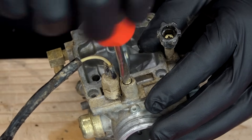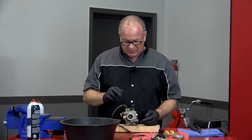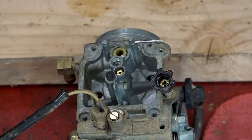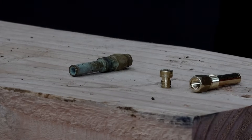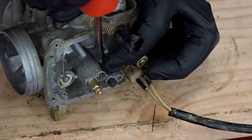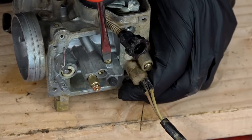The reason this adjustment even exists is so you can adjust for different changes in altitude — if you were running at a real high altitude you'd only run this maybe one turn out versus two. Next, let's take a look at what I call the slow jet. There are no O-rings, so just go ahead and drop it in — just go until it's seated. Our main jet is actually made up of two different pieces: you have the jet that goes up top and then what they call the emulsification tube that goes into the carburetor. These two pieces are welded together by this point. Put just a little bit of torque on it so it doesn't come apart — don't overtighten, just snug it down. There's also one they call the start jet, which has something to do with the priming bulb on the side — since we're in it and the kit included it, let's go ahead and pop it in.